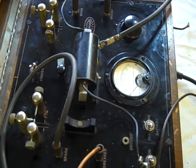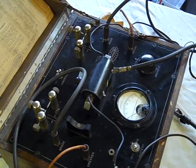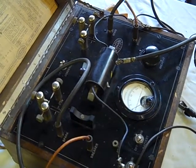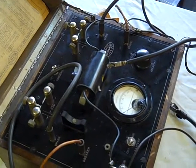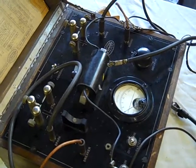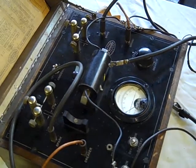That's really what a coil secondary is about. There are two windings in a coil, basically. You have the primary — that's the one that picks up the magnetic flux, and when you're testing with a battery, that's the one you induce voltage to. Then the secondary is only wound around but not attached to or grounded to it at first. The secondary winding is the one that fires your spark plug. On a single coil, one side of the secondary is grounded and the other side is open — that goes to your plug. On a dual coil, both windings are open, one to each of the plugs.